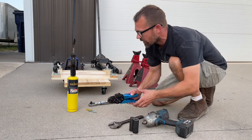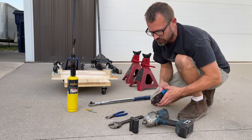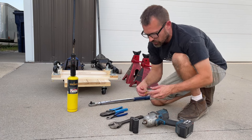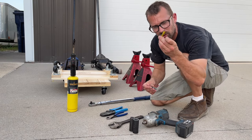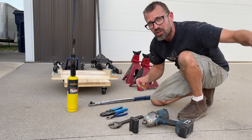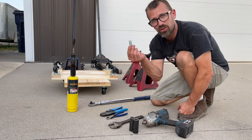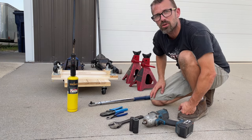And then for the wiring, because we've got the brakes, I've got a side cutter, a crimper, a torch to shrink down these butt connectors, and then I've got these butt connectors. I have somehow misplaced one of my yellow ones, but I've got two different sizes because on one of the sides we've got additional wires and they're going to require the bigger butt connectors. On the other side we just have single wires and we're just gonna need the blue ones. So that's the parts list. I'll put links in the description down below.